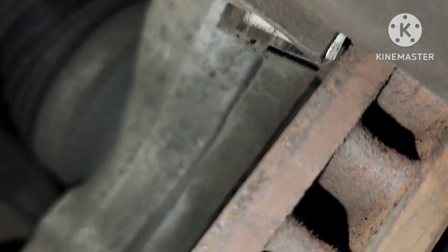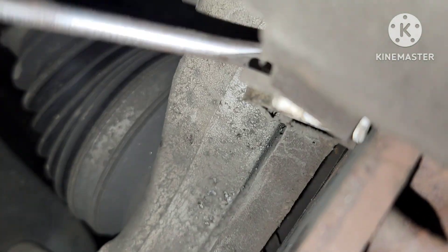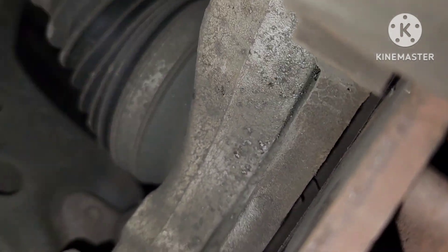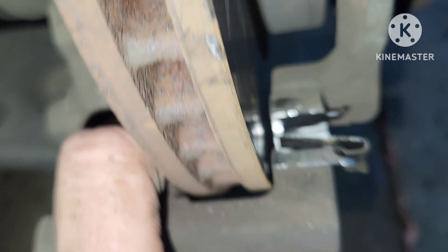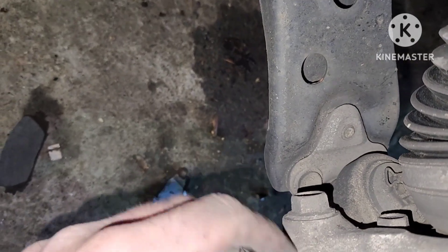It's a little easier to use a screwdriver to get these springs off. You can also put ceramic brake coating on the slides — I just didn't have any this time. Usually the kits come with it, so you can put some on there to prevent noise. They usually slide on pretty easily by themselves though.